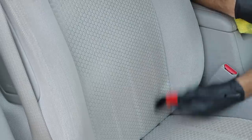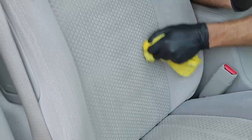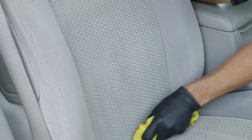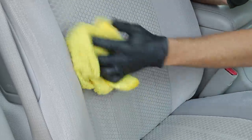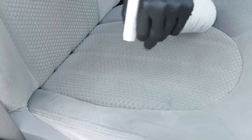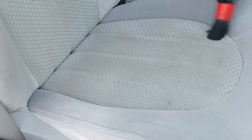When it comes to choosing a brush for cleaning cloth seats, I always try to err on the side of caution and use a softer bristle brush first. If needed, you can jump up to a more aggressive brush that's harder bristled and larger. But I always start out smaller and softer to see if I can get the job done first, because you never know the age of the cloth seat — you might start seeing pilling or abrasion caused by your brush. So I always try to err on the side of caution when starting out.